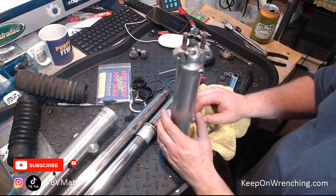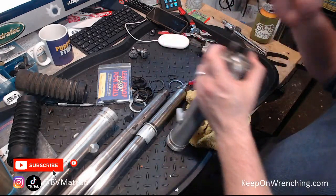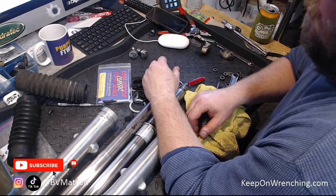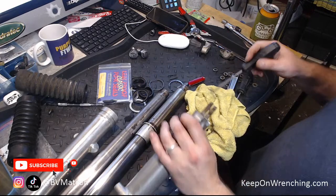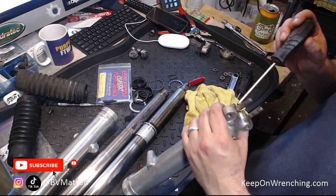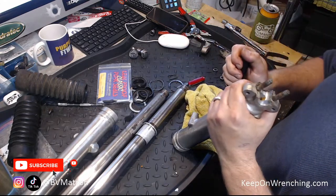Kenji, working on a KZ440 today. I put everything back together and ran the bike. The gases from the engine started to push back into the carb boots and shot out the side. Do you think it could be valves? Started to push back. Yeah, that shouldn't be pushing back. Did you check your valve clearance on that? Make sure you adjusted all that right. Anybody in the chat know maybe what that could be? That sounds like a major scary thing, actually.